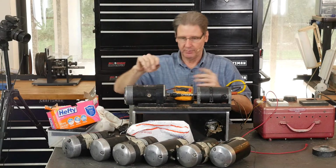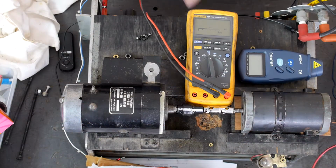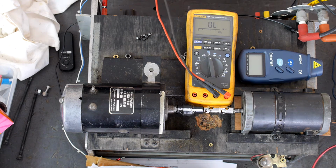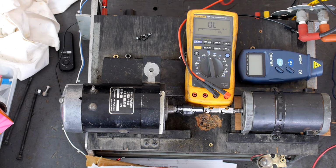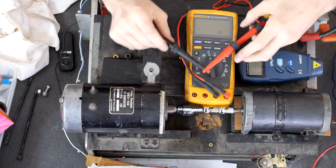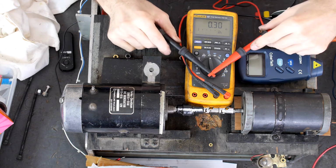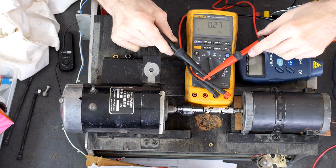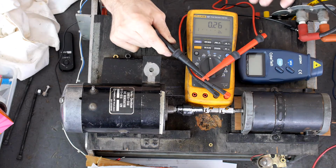So let's go through the sensible way to check if it just walks in the shop. So this is a good ohm meter. It's got to measure down really low. Low enough that it'll actually give a reading if you just hook the two leads together like this. Can you see that? What's it point to? Shake them a little bit. 0.28 or so, 0.27 ohms.